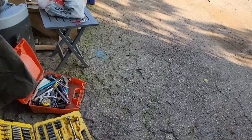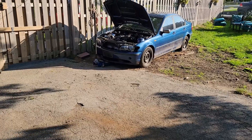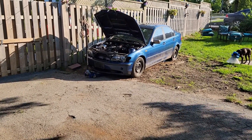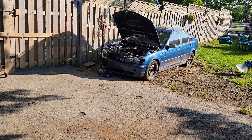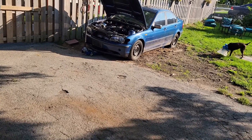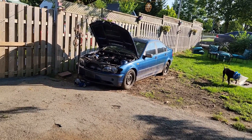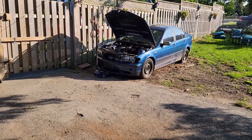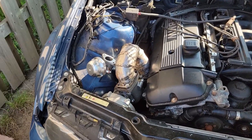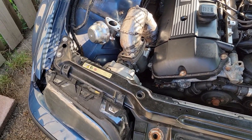I have a flex pipe that I just bought so that we can use that — so it's not one rigid piece. If I have time I'd like to get the oil feed and drain going into that turbo, but we'll see about that. We have to get the wastegate dump valve done, get the full exhaust made, then oil feed and oil drain. From that point it's just working on fuel — got to set all that stuff up. I'm just gonna take that turbo off now so I'm not spinning that turbine without any oil going through it.